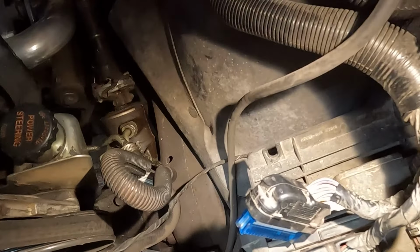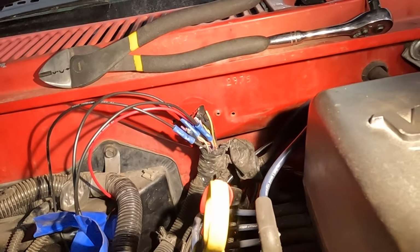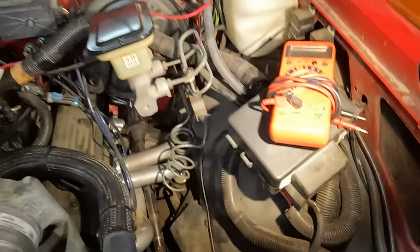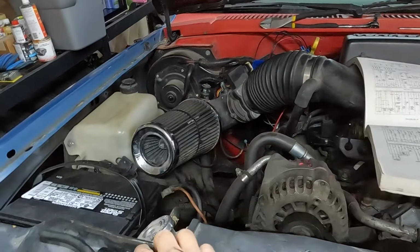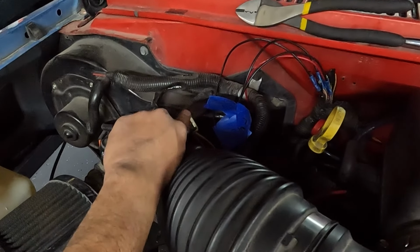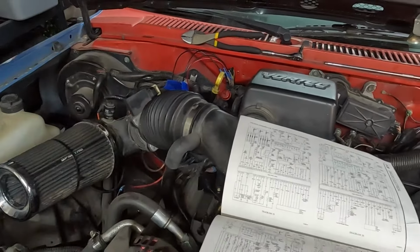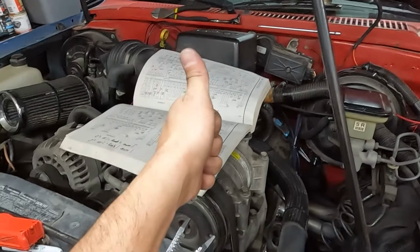What I did is I disconnected the plug here and I looked at my pinouts and then I used an ohm meter because there were a couple purple and whites back there and a couple tan and whites. And so I just touched the pin I needed here with the black, and then the red I touched the wire. Beep! It's touching, so we know that that is the wire. And then I went ahead and I got the MAF sensor, stabbed it, the pink or the orange, I guess it's supposed to be. And then I found the orange there, and then the ground, I just grounded it to the block, touched the black wire, it grounded. So I know those are the 4 wires I need for my O2. And we should be good.